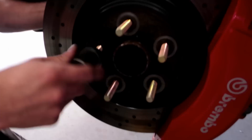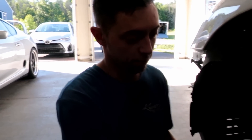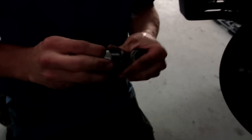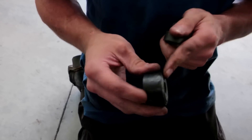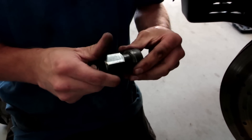All right, so I'm about to change the oil. BB's right now putting in the ARP extended studs for Tony's car. We're gonna go over that in a little more detail — I'll show you guys when he does the back. It's actually quite easy, there's not much to it. Ideally I like to remove the rotor, but it's the same concept — it's a flat surface so you know it's gonna be true. This install tool is pretty nice to snap on. There's a washer ring in my bag, Tony, on the side pocket. Now there should be another one. And then you have what would rest on the rotor — it's threaded. There's this style which has a bearing that rotates on. You'd use a lug nut — same idea — it'll draw the stud through. But the other one's a little beefier and it's threaded. We'll show you guys when we do the back one so you can see it firsthand.